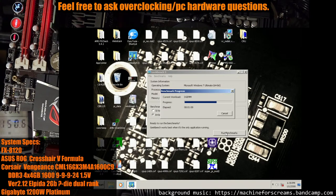And then I do have some PSC that can do like 2600, 8-12-8. Actually, I think it even does 2666, 8-13-8, something like that. Or 2700, 8-13-8. But that only works on Intel. On AMD, it maxes out at like 2550, 8-12-8.